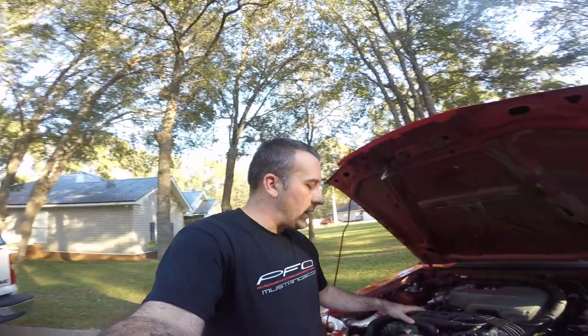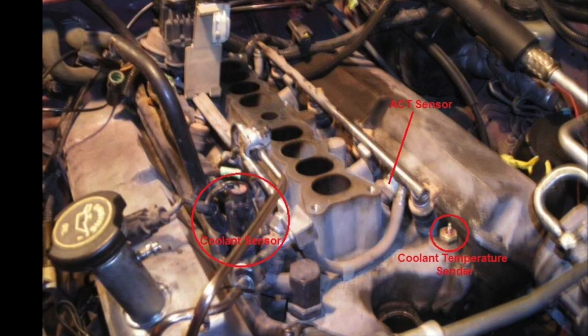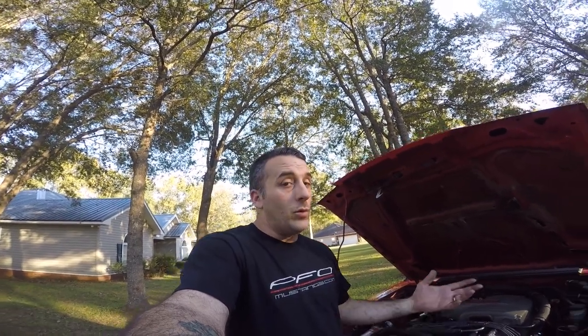Also, one other thing that I wanted to cover with these cars, I know I've had a lot of people message me lately saying that their car runs really bad whenever it's cold. Okay, guys, there's two sensors that usually are the problem here. That's the ACT, and I think that's the ECT. Those two sensors are usually a problem if your car has an issue with a cold start. In other words, you start your car up, it runs really bad. A lot of times they won't even stay running on their own until they warm up. Sometimes it's a minute to 2 or 3 minutes. It depends on how cold it is outside. Once the car starts to heat up a little bit, then the car will run a little better. And they'll run fine until they get cold again and you try to start it up, and then you'll have issues once again.